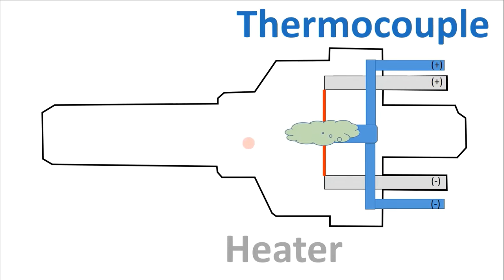Now one of the problems with freeze drying is that as we freeze dry our food, micro particulates, water vapor, perhaps even oils from the food and other substances can actually enter this thermocouple gauge and surround the heated wire. As the heated wire heats up, it will actually burn and carbonize some of this food surrounding the wire. As this wire becomes dirty, it becomes self-insulating - it's harder for heat to be transmitted from the heated wire to the thermocouple, giving you a false signal going back to the motherboard.